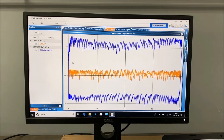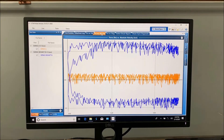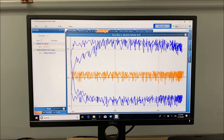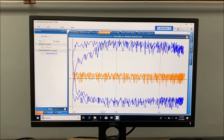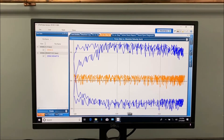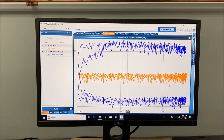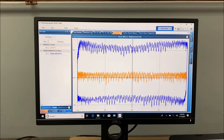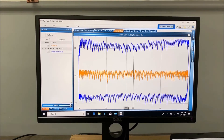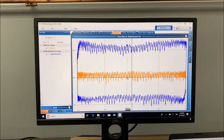So here are our two data files. I'm looking at force versus displacement first. You can obviously look at force versus velocity or any other way. Definitely need to add some smoothing, but for the sake of this demo I want it to be as pure as possible. You can actually see — this is with no shaft, and this is with the shaft. It actually has the shape of a force-versus-velocity plot that we're all used to seeing, as well as a force-versus-displacement plot. You can easily derive your data and see that you have created some drag — actual force pushing that shaft in and out. No doubt about it.